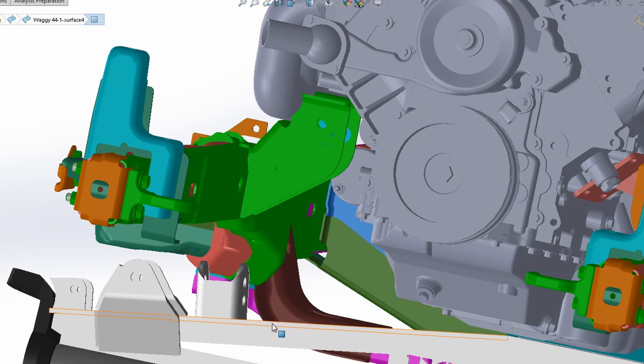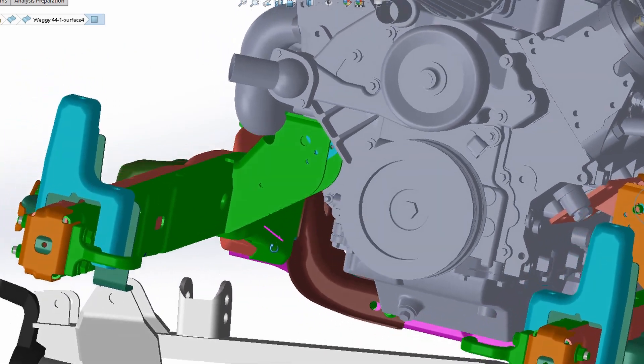The link goes through this little opening right here. I don't see any oil pan clearance issues and I don't see any issues with the motor mount. Even if there are minor ones, I can trim that. If I'm going to hit the motor mount I'll probably be hitting the oil pan too, so I'll have bump stops coming off the bottom of the frame here. Let's get out of SolidWorks and go back into the Excel sheet.